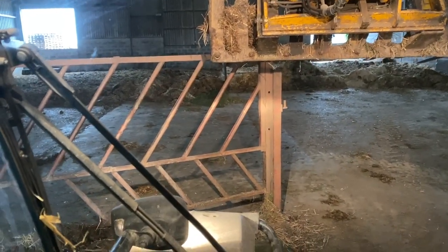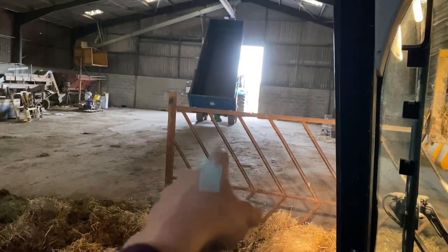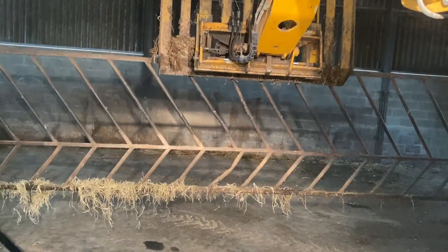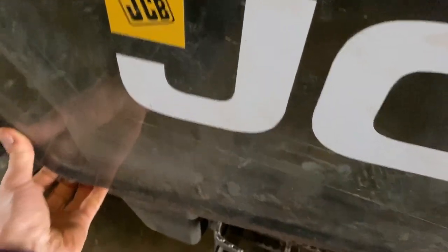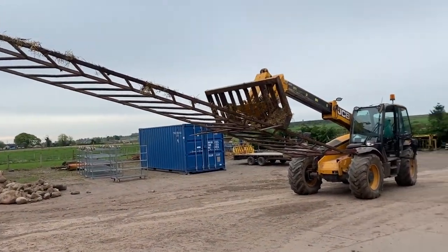These gates are to come out as well — hopefully that's going to come off that post easily. Kev's just bringing the trailer and re-torquing the bolts underneath — we use the trailer for half a day after replacing the U-bolts and nuts, so he's re-torquing them because they can jiggle and need tightening again. If you lay the gate down and come in from the end you can take it out. The seam on this is goosed, so before the window falls off and smashes I'm going to take it off, get some sealer and put it back in — but I've not got any just now.